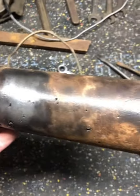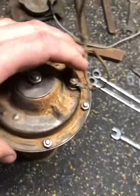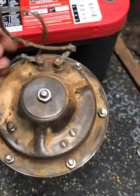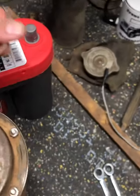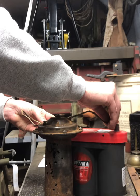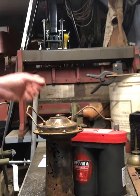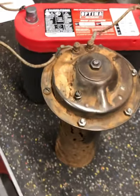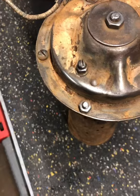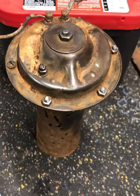I'm gonna clean everything up and attempt to reassemble this using as much of the original pieces from the Spartan horn as I can. I've got my six volt battery right here, and the first step is to make sure the horn actually works. I've cleaned off some of these contacts — let's see what we got. That is a very, very good sign that the horn is at least internally intact.